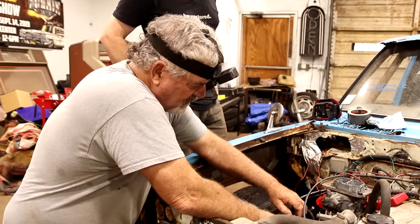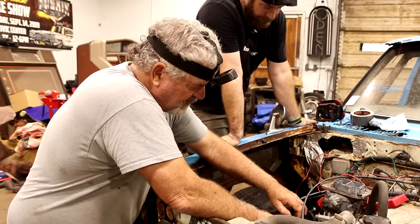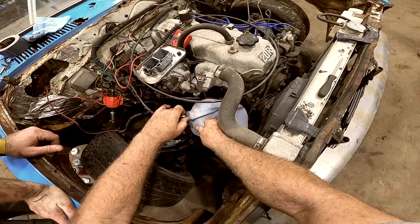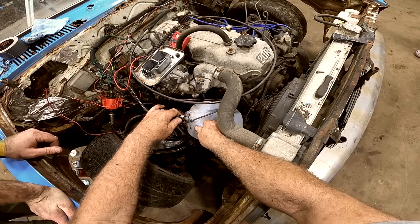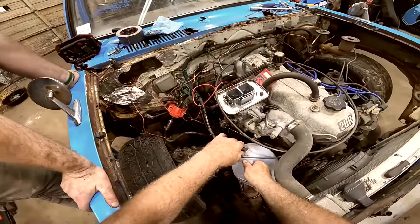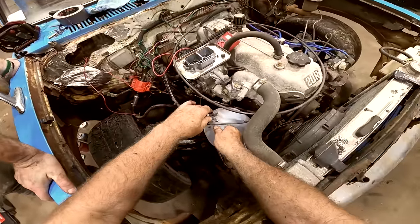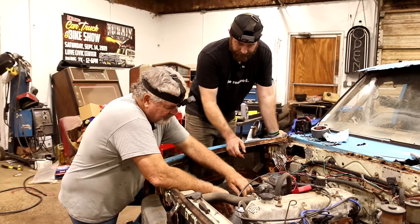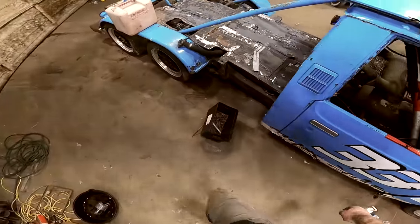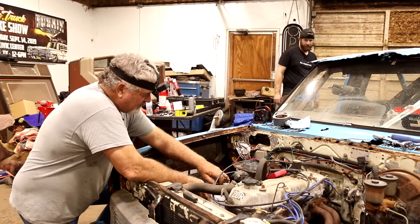Taking a while, huh? Mm-hmm. That pump needs to be closer to the tank so it can push rather than pull. Well, I wonder if we got a stopped up line or if it's just too far away from the tank. Or a rusted out line. Could be that too, yeah. Can you feel anything? Uh-uh. No. Yeah, it could even have a bad hose back here, you know what I mean? Where it comes back into this tank. Right.